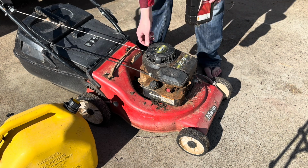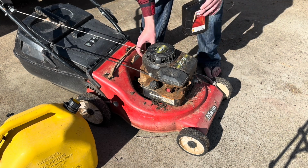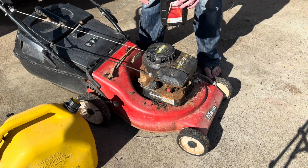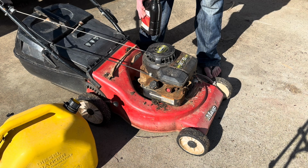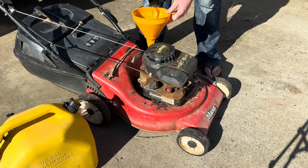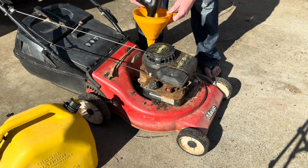So the throwaway oil is just whatever I can get cheapest. It's not going to spend long in there, it's just a lubricant to start it up. There's no point putting expensive oil in there if it's just going to be a chuck away block. So since we're completely dry, I'll put about half a litre in there. Won't be completely full, but more than enough.